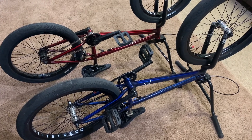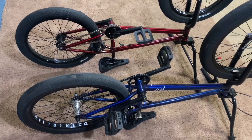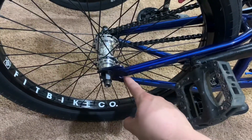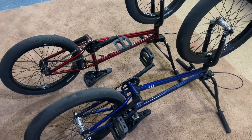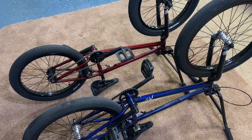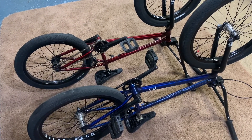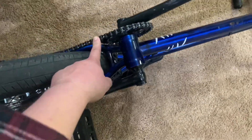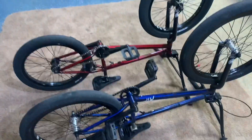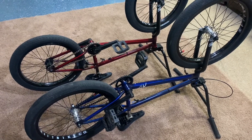For years, I've had my axle damn near falling out the dropouts, or I've actually had to cut the dropout to slam the wheel. Part of that is just because when I was younger, I wasn't able to afford $40 half-link chains. I was just running $10 Walmart chains that were always stretched out, and I had to keep plenty of room in the back to slide the chain over the sprocket to change a tube because I didn't own a chain breaker.